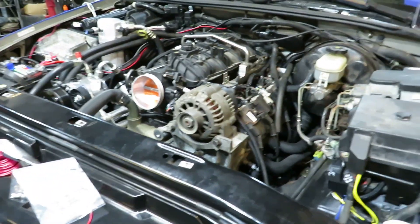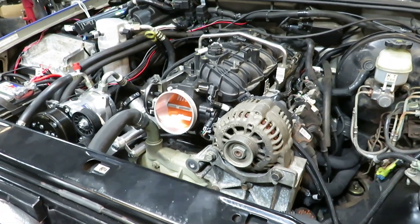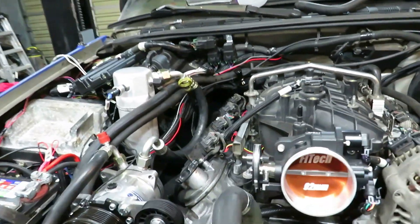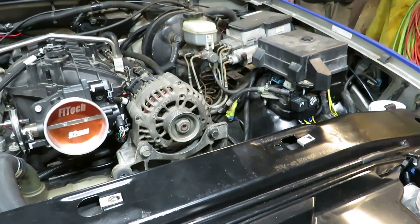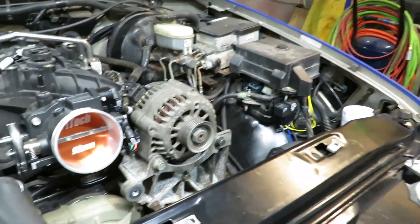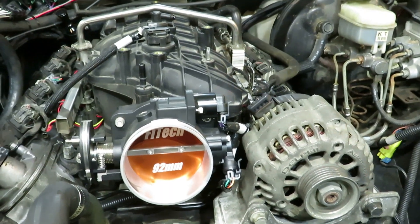No leaks up there. It's sucking a lot of air — it's got vacuum leaks. I never hooked them up. So that's good for sure. It's got a vacuum leak. This one I believe was supposed to go up to that one there. I've got a PCV line, and then just a rubber hose from there to the other spot.